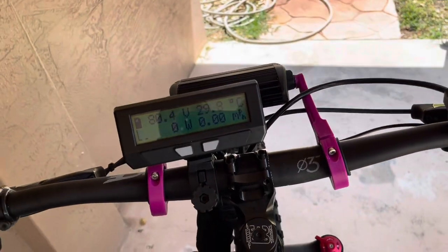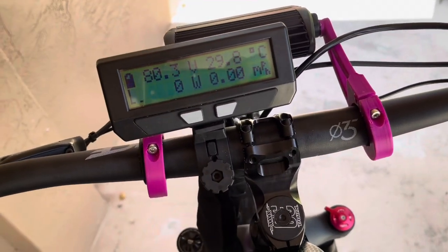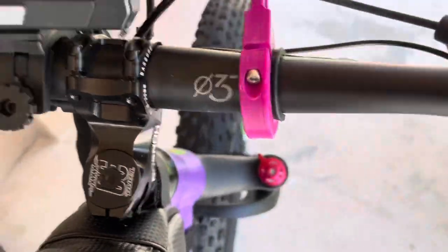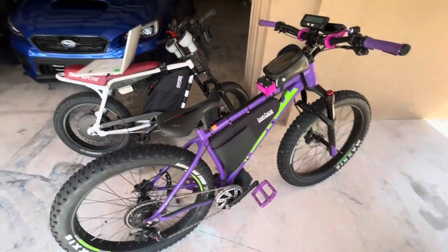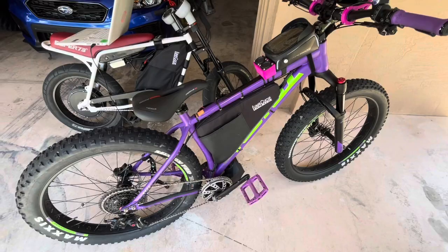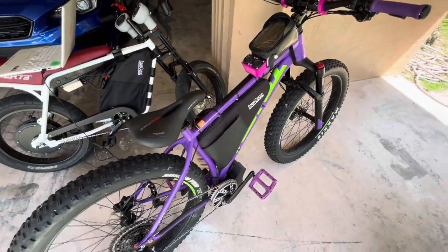You have to use field weakening to run that much power — that's where you'd otherwise get faults. Using the configuration shown in this video, if you have the pack for it and have the steel gear and chain, you should have no problems having quite a bit of fun. This thing will do wheelies on command under 15 miles an hour and is capable of doing over 45 miles an hour. Hopefully this video helps somebody — I'm just an enthusiast, trial and error, figuring things out. If you use this setup let me know, give some feedback, and if you have tips to make it better I'm all ears. Thanks for watching and have a good day.